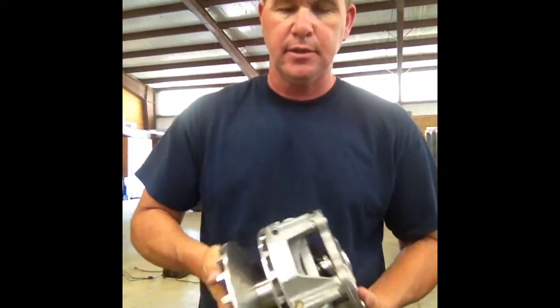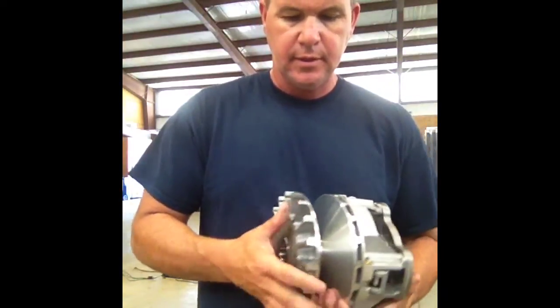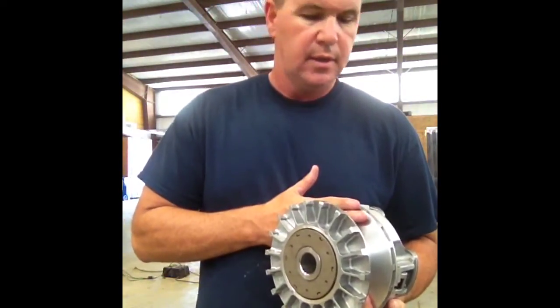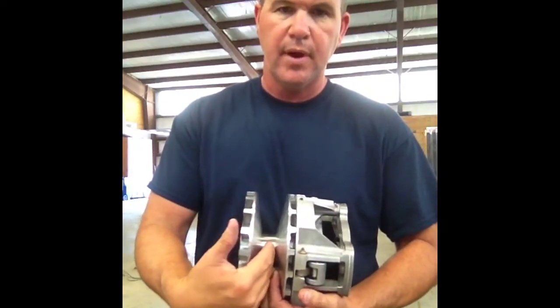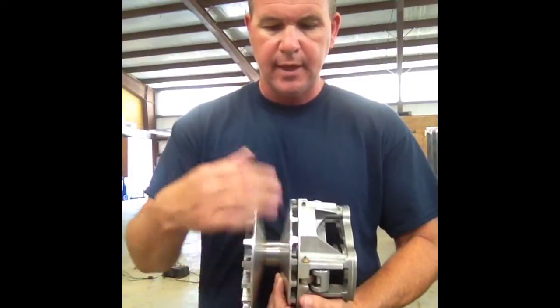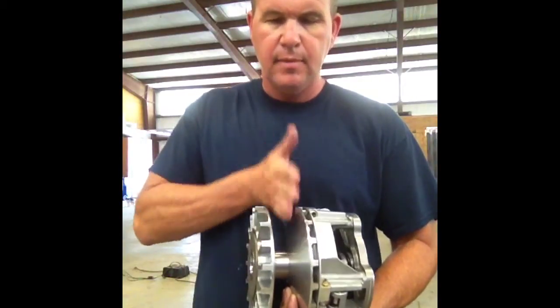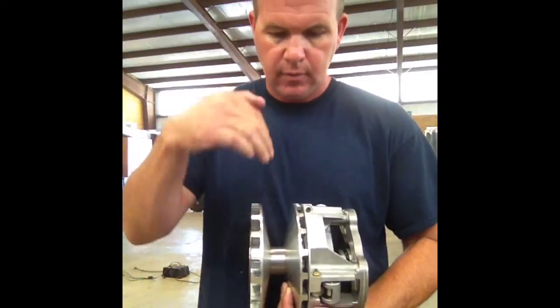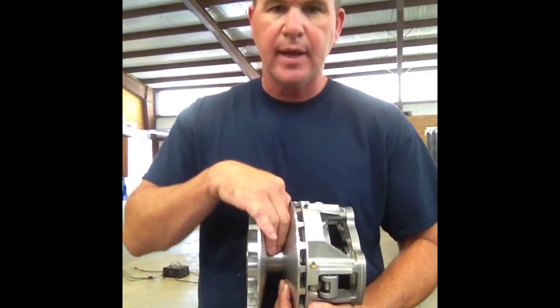Several advantages with this: you're not going to be burning belts, because your belt's going to be in constant tension with the primary clutch, not spread apart wider than this at idle, with this turning and your belt not, and then when you give it gas it comes in and closes on it.